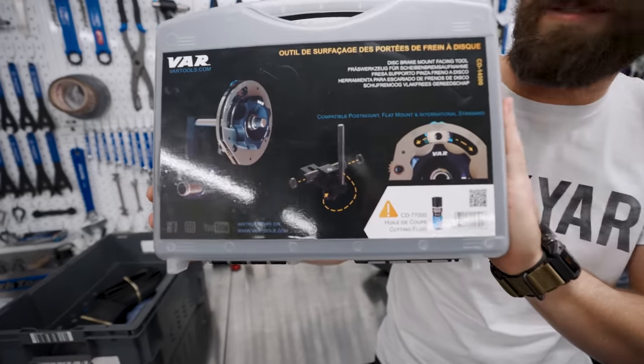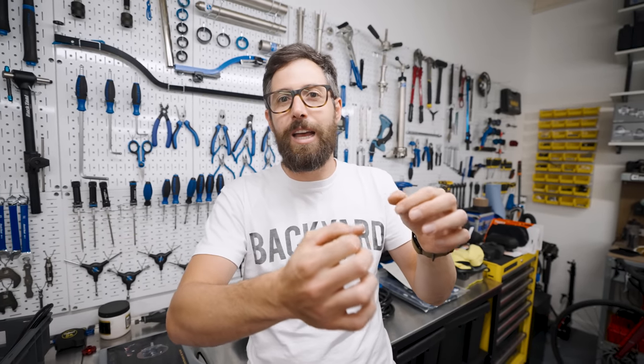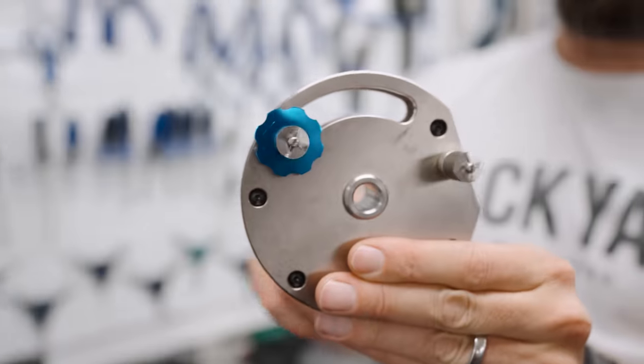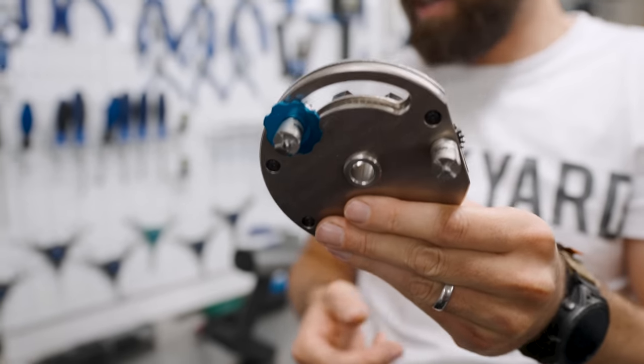That's one for the mechanics out there — the VAR disc brake facing tool. When you've got disc brakes, your calipers need to be mounted perfectly straight. If they're slightly skewed or over-painted, you're going to have rotor rub. The trick of loosening the calipers, pulling the brake tight and re-tightening just doesn't work if it's skewed. In some cases you have to actually face the frame — take some metal out of each disc brake mount to make it perfectly flat. Almost every other facing tool works on one mount at a time, making it hard to get them perfectly even. This tool faces both at exactly the same time, so you get them perfectly faced evenly. Very expensive — I think 750 quid — but it's just the greatest bit of kit.